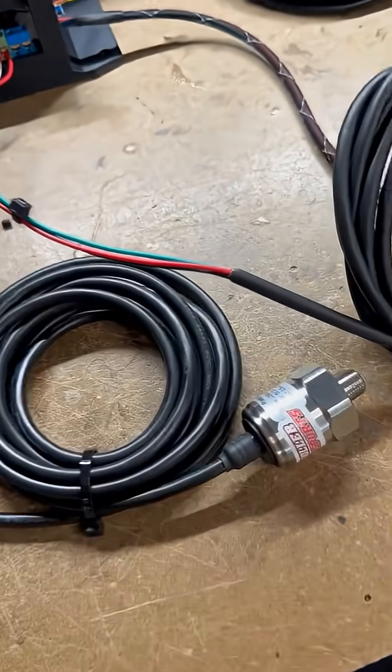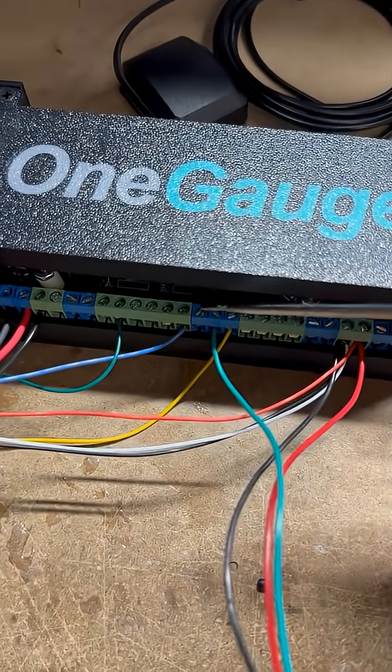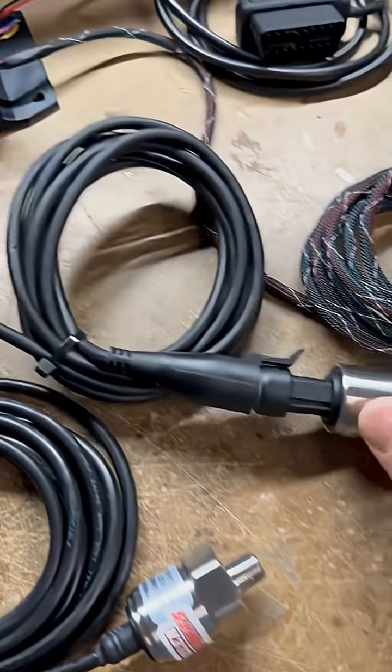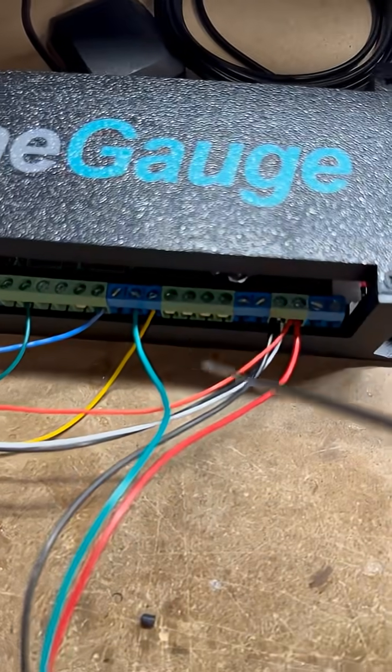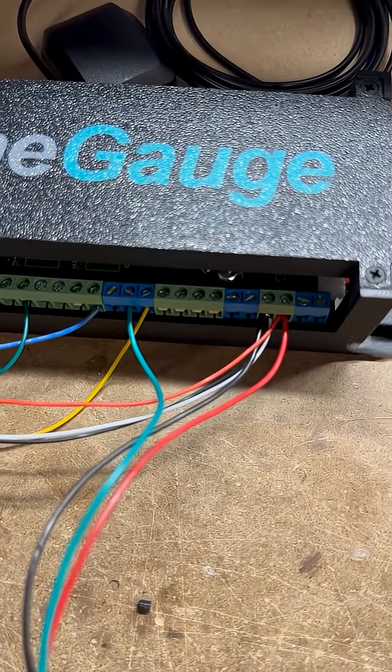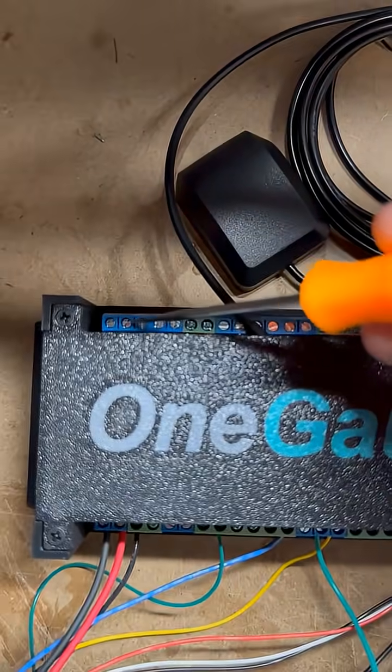This one has a two-wire temperature sensor. Moving on, we have seven linear 5-volt inputs, which take things like pressure sensors and AFR sensors. We have a combo sensor here as well as a standard pressure sensor. For AFR and O2 sensors, we just use the linear 5-volt outputs that most of them come with.